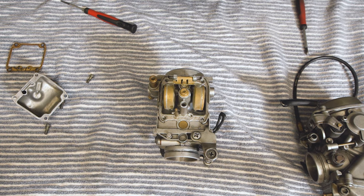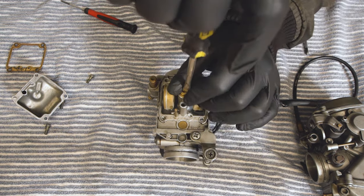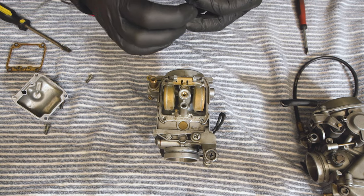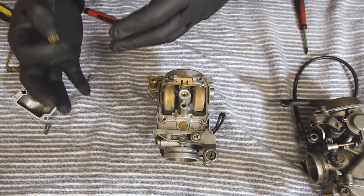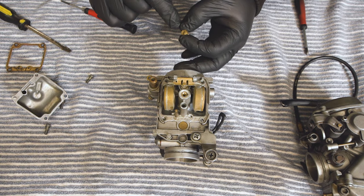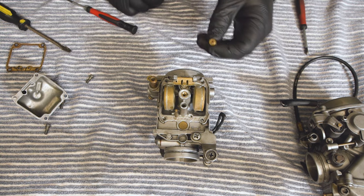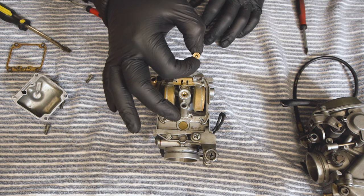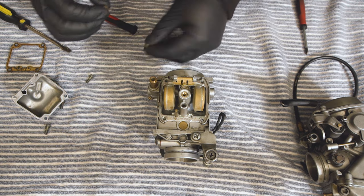The next thing we have in here are the jets — this is carburettors 101. If you can't get your bike to start and the fuel can't get to where it needs to go, check your jets. That's what this little brass thing is here. It has a hole that is a certain size rated to the carburettor or the fuel supply. You'll often hear about people jetting their carburettors — that's effectively getting a bigger jet with a bigger hole in the centre that will allow more fuel through, giving more speed. Check that you can see through it. If you can't see through it, clean it. Get a pipe cleaner, maybe some compressed air, squirt that through, and then pop it back in. Don't forget your washer.